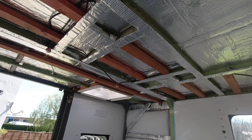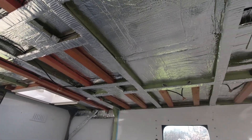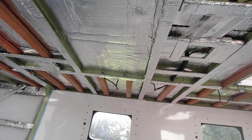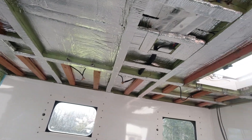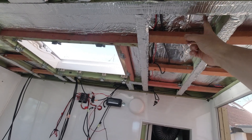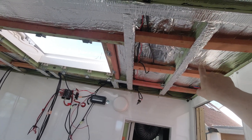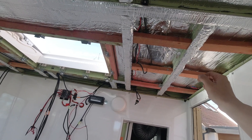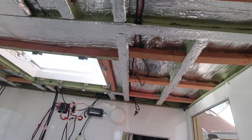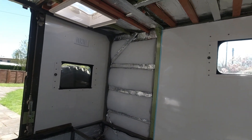I looked at various different methods of putting a ceiling in. What I settled on in the end was tongue and groove, dyed darker to sort of match the furniture board. There's a silent coat behind it — that's a padded foil — and this is actually adhesive thermal wrap for hot water pipes, but it's to try and stop it being a thermal bridge. You can see it running along the frame there too.